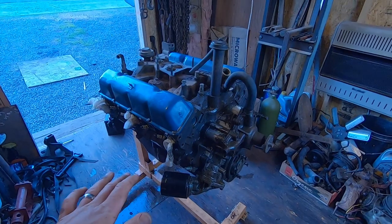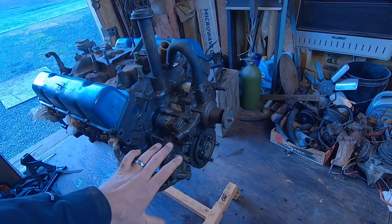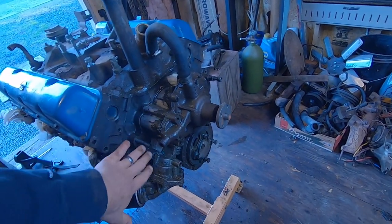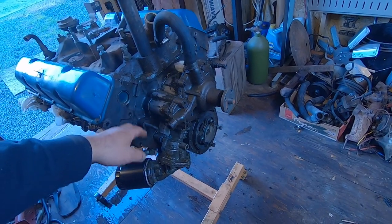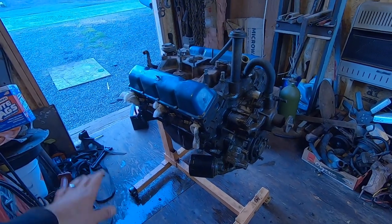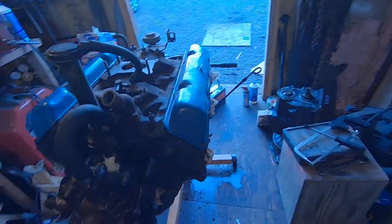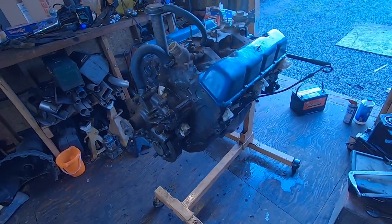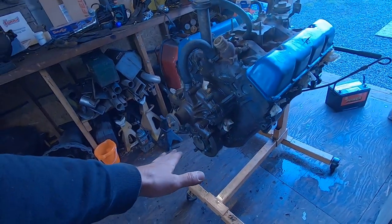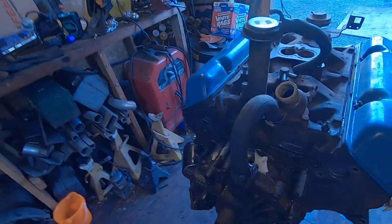It's not perfect yet, but I got a lot of the big chunks of grease off. I didn't do a lot of cleaning on the front because I just wanted to get the grease around where the gaskets are — I'll clean that up on the bench. A little engine degreaser and scraping and using a brush to get all the big chunks of grease off. Now we'll pull the harmonic balancer and the front cover and see what it looks like in there.